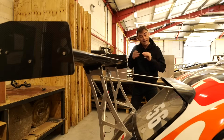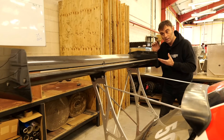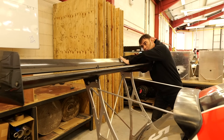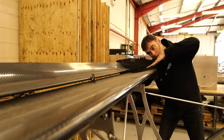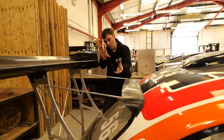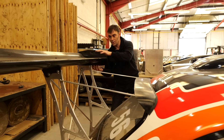At the rear, it pretty much looks the same — it's got that huge, massive wing — but the main difference is the angle of attack of the wing. We've changed the angle to be the exact angle that Catesby Projects' aerodynamics report told us it needs to be, and it looks a little bit weird. You probably can't see it on camera, but this actually is sloping slightly upwards, and the angle of attack of the rear is even more. The reason is they wanted the primary and secondary wings to actually work as one. The way it curves, it curves as one, and the reason it's slightly tipped upwards is because the air coming off the body comes down slightly. So this works in conjunction with the way the air is flowing off the roof, and also the diffuser underneath — this and the diffuser work in harmony.